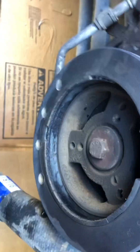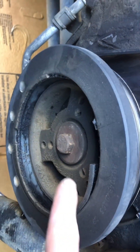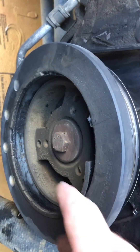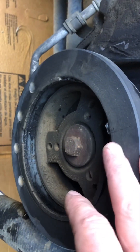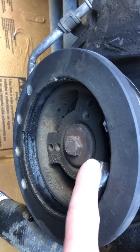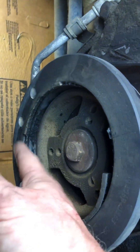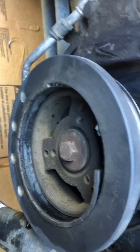Once I'm down, I got all the radiator out and everything. You can see there's a rubber grommet in between these two. This is a balancer and the rubber is there to help stop wobble. So the rubber fails, then the outer ring can pull right off. You can see in here — these two are supposed to be lined up. So it's failed.